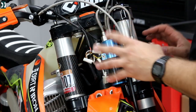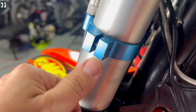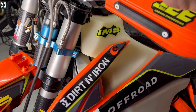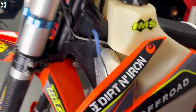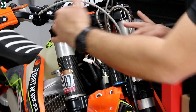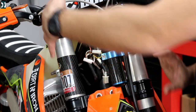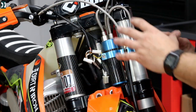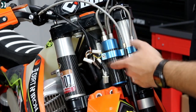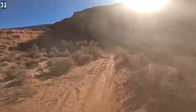If I really want to run a headlight with this tank, I would have to grind off the side right here — the sharp edges are hitting my radiator — maybe about a quarter inch off, then play with it to fit everything correctly. Some guys run GPS and all kinds of accessories, and there is a multi-mount bracket option for a headlight setup, so once you get busy up front this thing might be in the way. That's the only downside I've found so far.